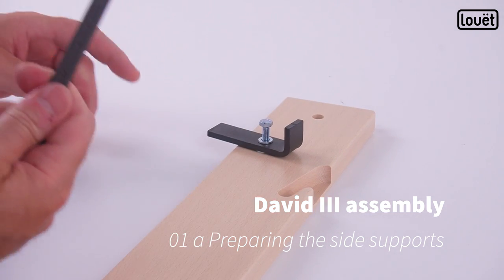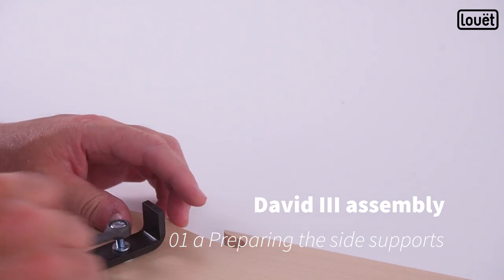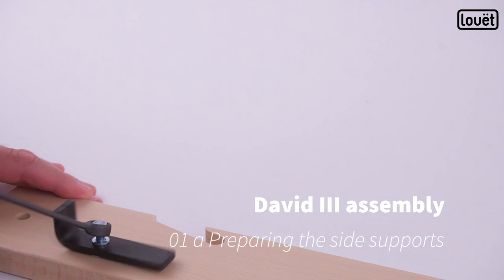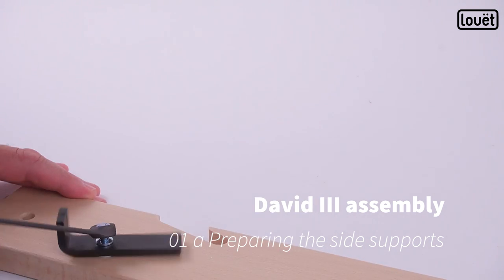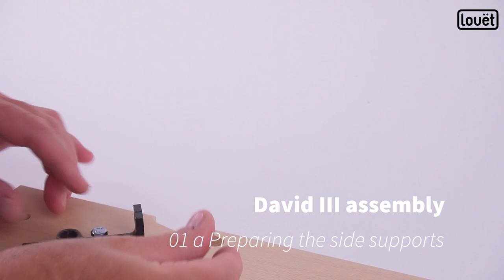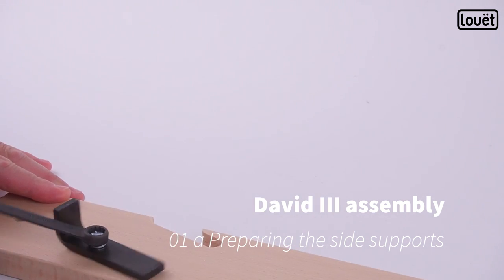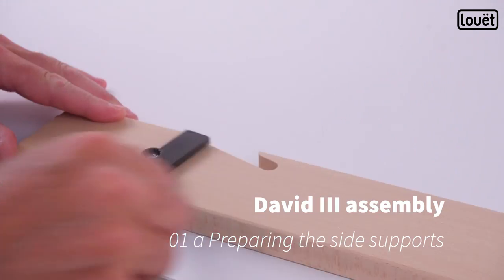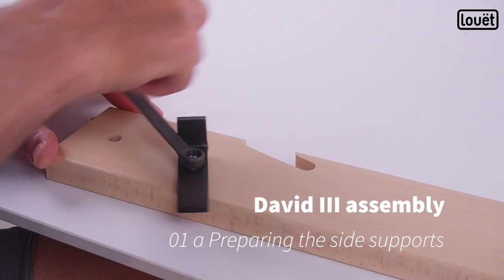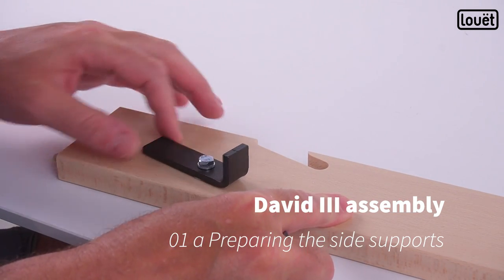Then you grab your 10 millimeter bolt and we're going to turn that. I'm going to turn it so that it's tight, and then I'm going to back it off a little bit because it needs to be just loose enough to be able to turn. But if it's too loose, then you're going to have a lot of play in it and you're not going to like that. So I'll show you what I mean as we get here. That's going to be getting close. Maybe. Yeah. All right. So it needs to move freely, and that's not.